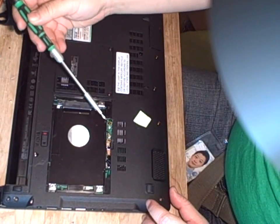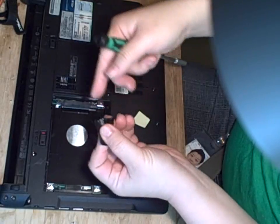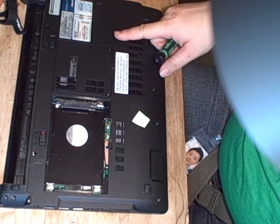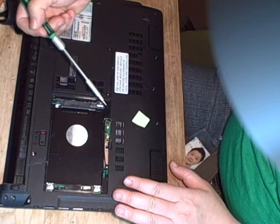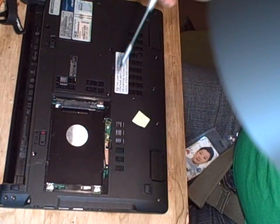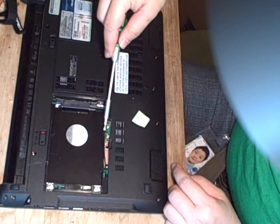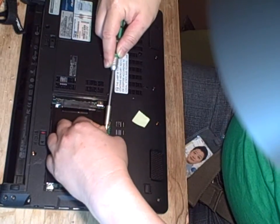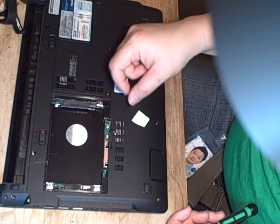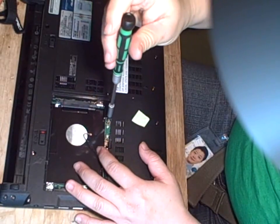The wireless card is here. And if you can see, there's actually a giant black tape — I already removed the other end — but there's a giant black tape that used to tape the inner motherboard and the wireless card together. You can see the wireless card is here. So once you remove the tape however you like, you should be able to swap the antenna. This is antenna number one. Unfortunately, the design flaw in this machine is that it doesn't have an antenna number two.